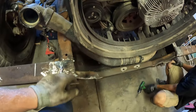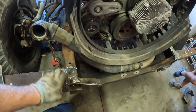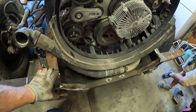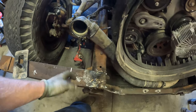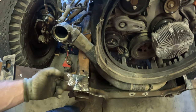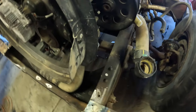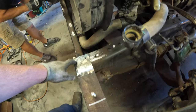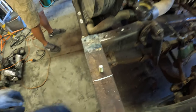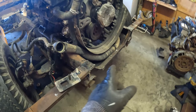We're going to drill two 3/8-inch holes for the frame — one here, one here — and run 3/8 bolts to clamp it all together. We're also drilling a half-inch hole here where we're going to put a bolt that's basically going to act as a dowel for our cooling package to sit on, just like the factory mounts over in the F-250. These are quarter-inch right now; that's our half-inch bolt sitting there and we're going to weld the bottom of it — that's really all we need.